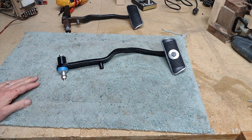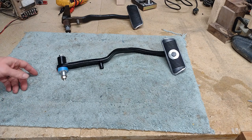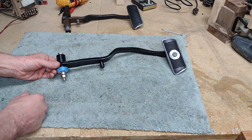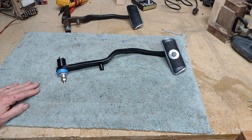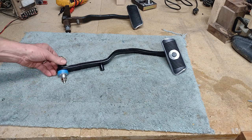The company has played ball with me on this. I asked what it would take to get rid of the power brake assembly — because if I go back to manual brakes I don't have to use the upper hole, and I can actually work on the pedal without removing the power brake booster, which is a real bear to get in and out. A master cylinder for manual disc/drum brakes is on its way, generously supplied, but it still doesn't make up for all the headaches.